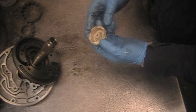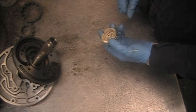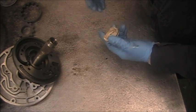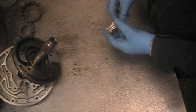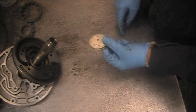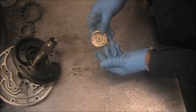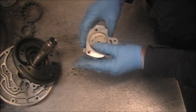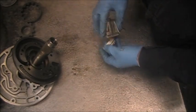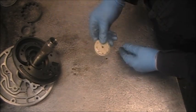Now, let's say there is no crack on the back — how long has this been inside that transmission? If you reuse it, it may start to crack within a month. It may be developing some cracks on the inside that you don't see. If you can, I would replace this one with an aluminum or a brand new plastic one. Either a brand new plastic piston or an aluminum piston. Again, if it's in there working fine, you would never see those cracks because it's on the backside — even if you're making a repair. This is in a 4L60E, 4L65E transmission.